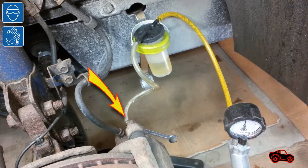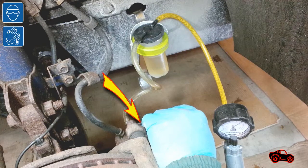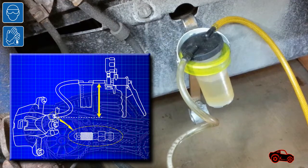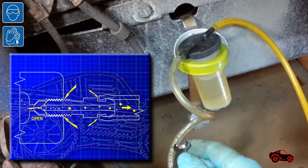The front brakes were more problematic because sometimes air was entering between the threads and air bubbles were showing in the hose. Different ways to seal the threads can be used, but at that moment I simply tightened the bleeder screw a little more and reduced the vacuum level to lower the ratio of air in the fluid being transferred to the jar. As long as there is a constant vacuum applied when the jar is higher than the bleeder screw, the air going through the threads or around the head of the bleeder screw doesn't get into the braking system. But it makes it difficult to see if bubbles are coming from inside the braking system when different sources of bubbles are present.